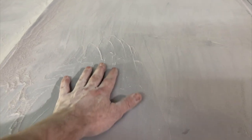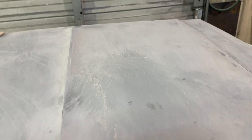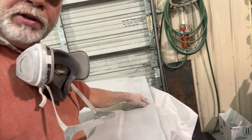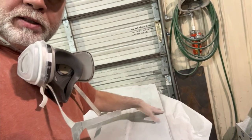If you notice it in the beginning when it's in bare steel, you might be able to heat it a little bit, cool it, it'll stiffen up. If it's not very bad, this one's not bad at all. As long as I use a block that spreads the pressure out, it doesn't move up and down like that. However, if you've got one that's moving a lot, you gotta figure out how to stop that. Sometimes you can put something behind it to hold it just to give it a little bit more support while you're blocking. If it was close to an edge over here, it was moving up and down, you can tap that edge a little bit and that'll firm it up.